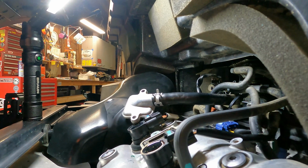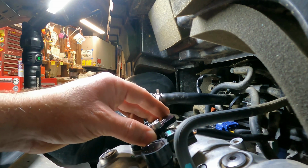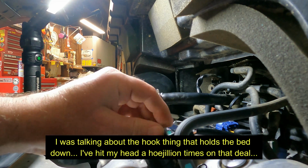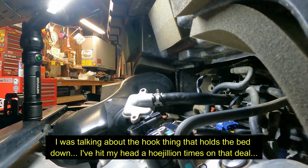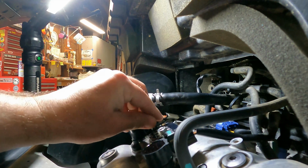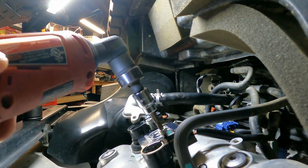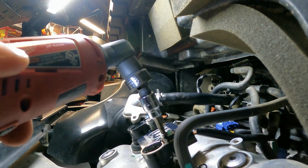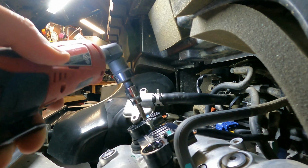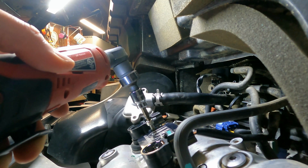All right, let's get the Weller Racing product part. Again, watching to make sure we don't chop our head off on that clamp thing. So we'll get these started. There's still enough thread locker on here where I'm not too concerned about these things backing out. All right, so then we're just gonna start these. Not gonna go bonanza fest here because we'll do it by hand, since whatever it said, 6 foot-pounds or 9 foot-pounds, that's not a lot of torque.